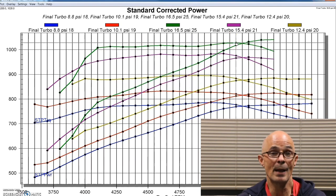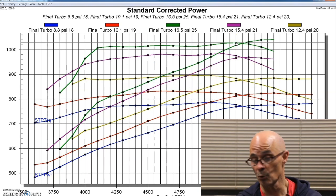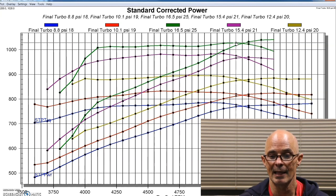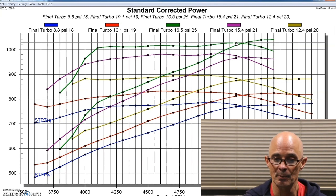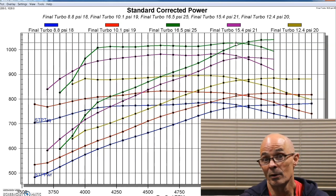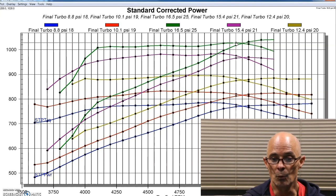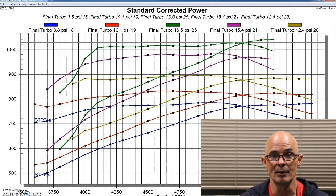Now there's certainly more power left in these GT45s. We know that each one of them will support at least 700 horsepower, and that was obviously with very high back pressure, and now that's fairly low. So I think on this application, these eBay turbos might support 1,500 or 1,600 horsepower on the right combination. We didn't do that on this because, again, I ran out of fuel.